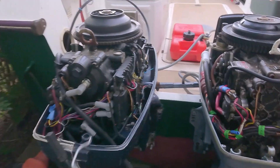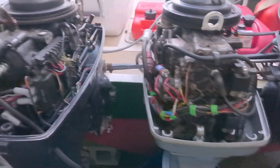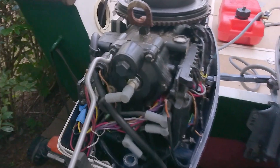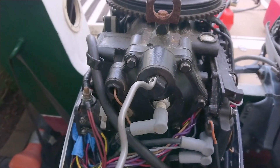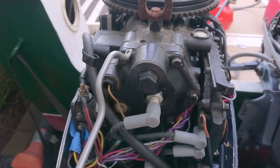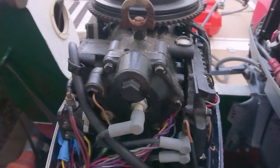So there are three different styles here. I have a 1990s 40 HP Evinrude, an '85 and a '96. Here is my favorite style of thermostat because it has this kind of rubbery outer part and it makes it easy to remove. Even if you kind of screw this up, I feel like it's pretty easy to get this thing off — it's just one big wide screw that you pull out and pop the thermostat back in.